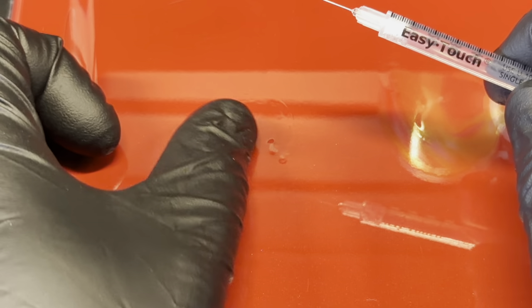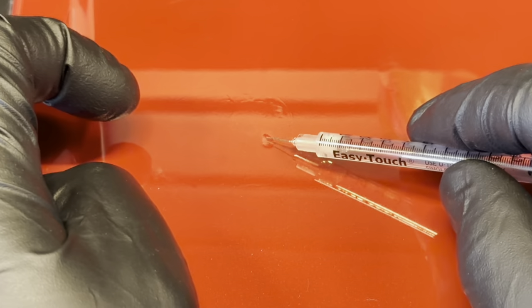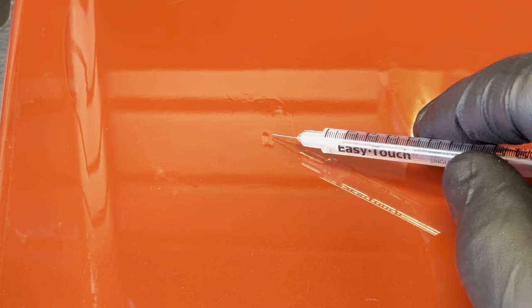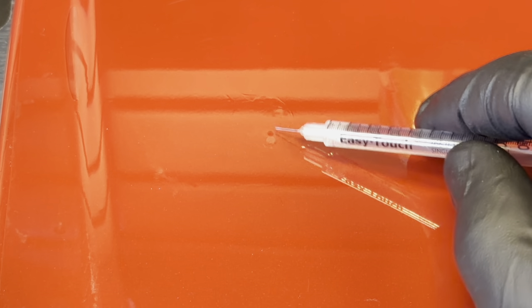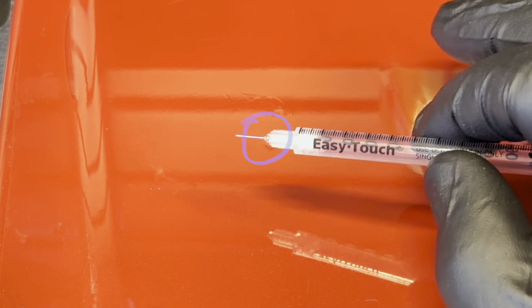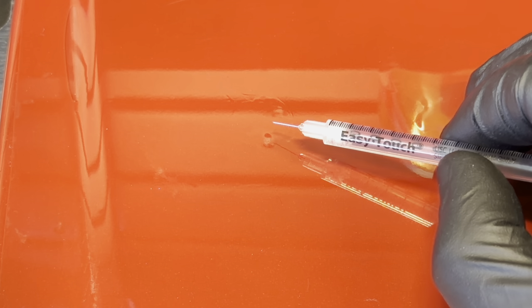Then you're pushing more force on the film, creating a potential large work mark. What you see here is just remaining moisture — that would evaporate away. But this area still has air, and we need to get that air out. If it was slip solution with DI water — not RO water, but DI water — and there was no air, just slip solution, we could leave that alone and it would 100% evaporate away with no mark. But if there's air in there, we have to get it out because it will not evaporate away.